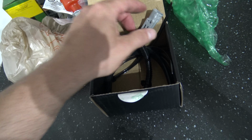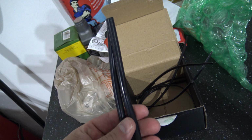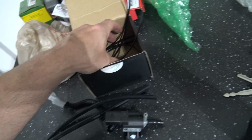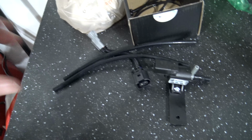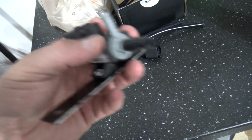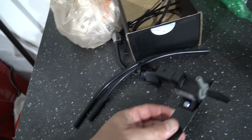And then, of course, just like with any kit, you're going to get the harness adapter. You're going to get two silicone vacuum lines. Now, I think with N75, he gives you the option to ship it with or without the replacement lines and the zip ties and all that. But from what I've seen, the factory hoses can be a little tricky to reuse. So in my opinion, you're better off just pulling the factory stuff off and replacing it, and that way you're less likely to accidentally break off these nipples and that sort of thing. But that's what it looks like, and we'll get this sucker in the car.